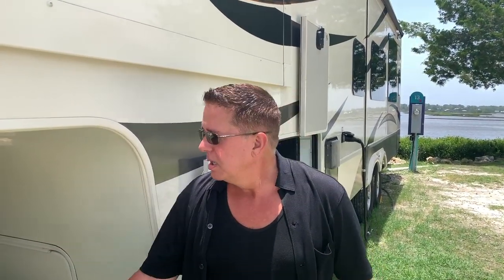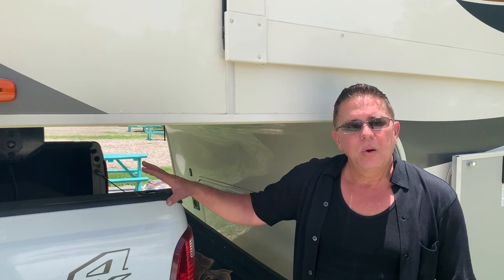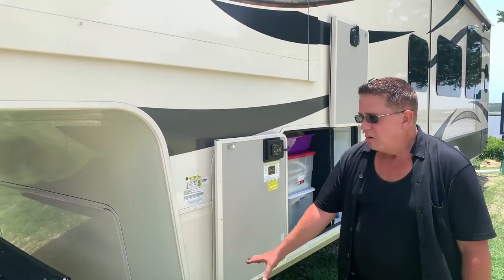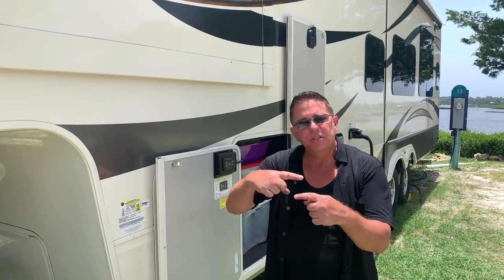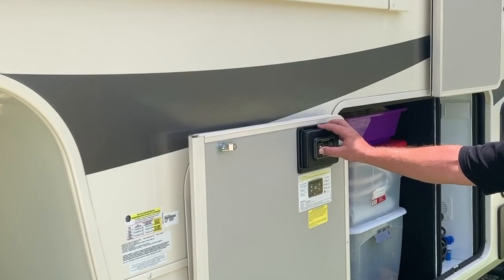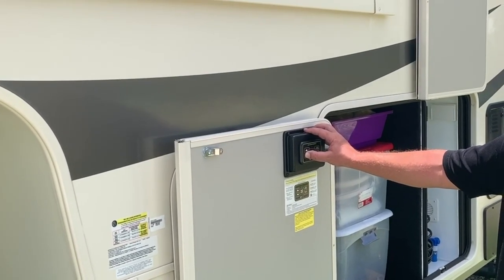We just got the truck engaged. We got everything hooked up. Also, make sure you hook up your tow power cable at that point. And then once everything's hooked up and we're ready to go, you just want to bring your jacks maybe just about an inch up off the ground, which is what we're going to do real quick. Okay, so now all the weight is on the truck,